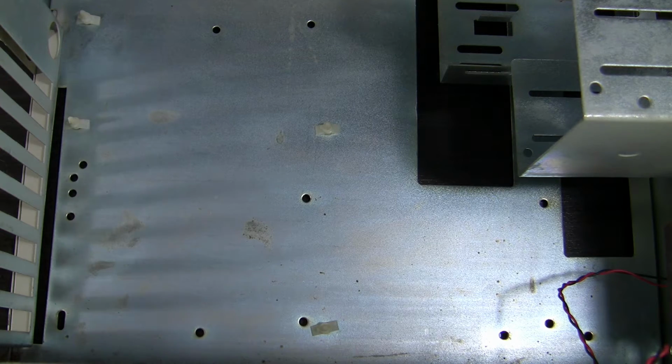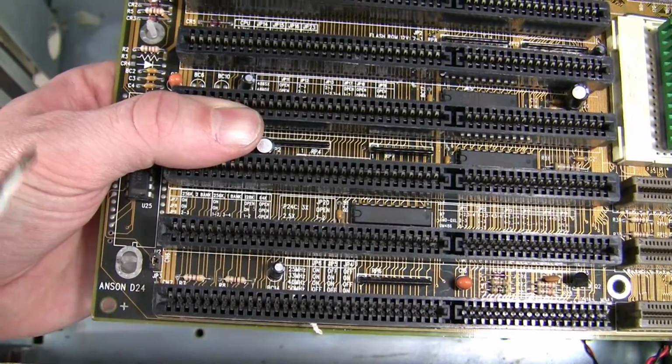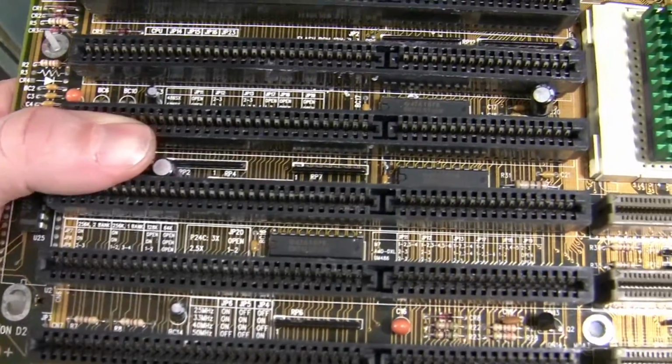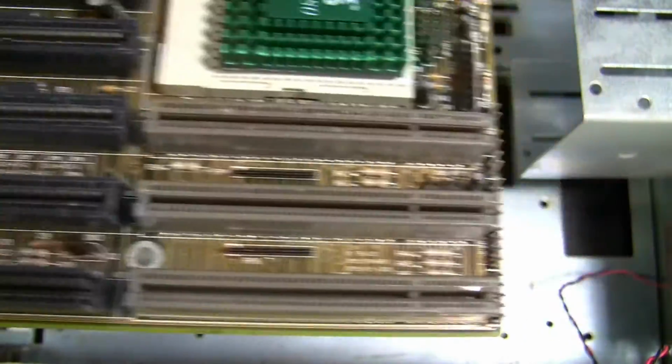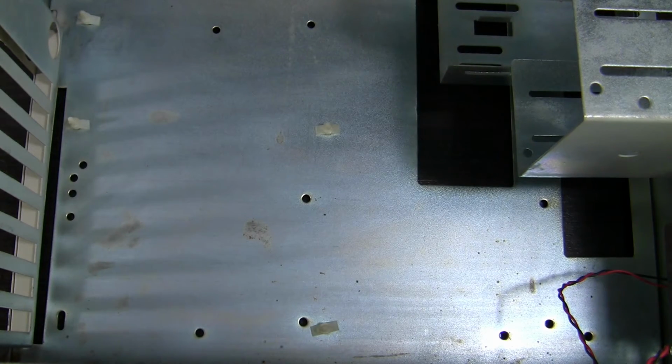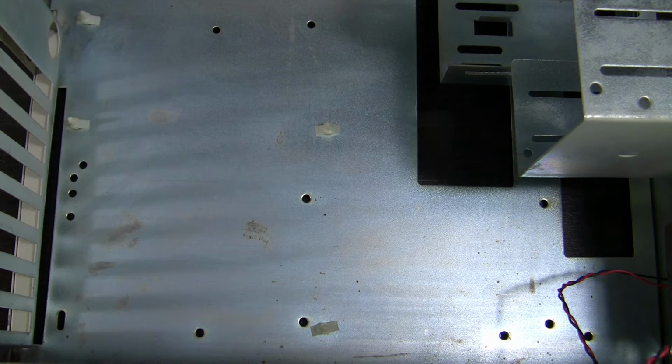I am now ready to attach the board. As I told you, I have mounted those plastic spacers. They will prevent the board from touching the backplane and creating a short circuit when subjected to force. What else? This backplane itself is not removable. This is inconvenient because it's harder that way to mount the board, and those arrow plastic holders do not provide grounding, so all grounding will go through the peripheral cards to the case. With that said, let's do this.